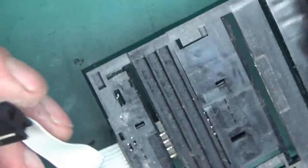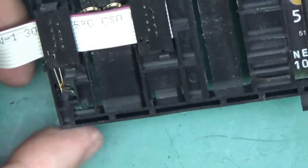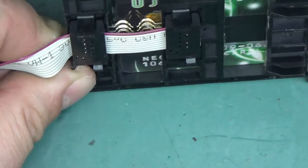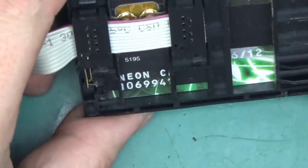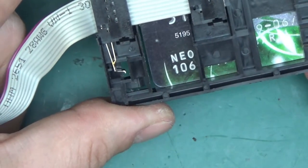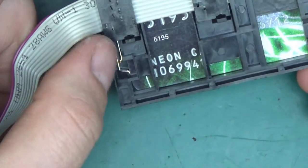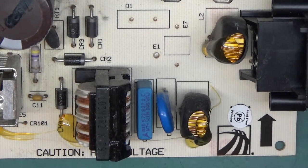Here is the smart card reader — really nice, because it's not soldered onto the board. It's got a wired ribbon cable, and I can use an old prepaid debit card to insert it. You can see the gold contacts making contact with the chip. There's also another pin which detects whether the card has been fully inserted — as soon as I press the card all the way in, it breaks that connection.